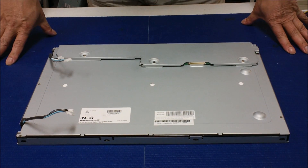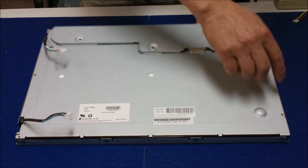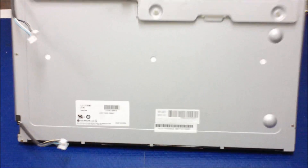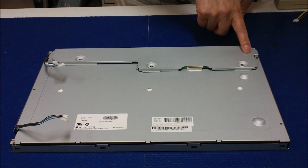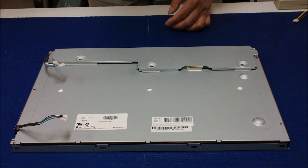To upgrade the LED light, it's not that difficult. First, you have to remove this metal frame. You remove the frame, then you put the lamp out. But first, you need to remove this back cover — the metal cover. There are three screws holding it on, so just remove them.